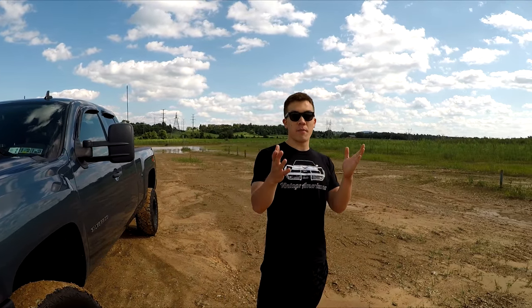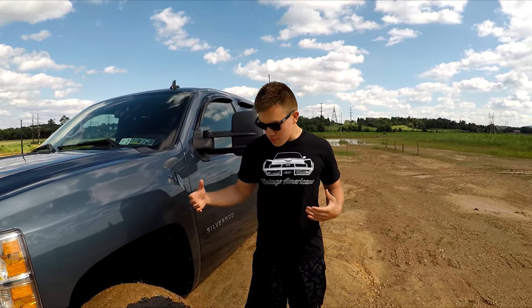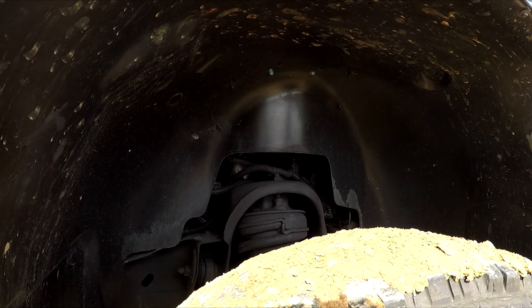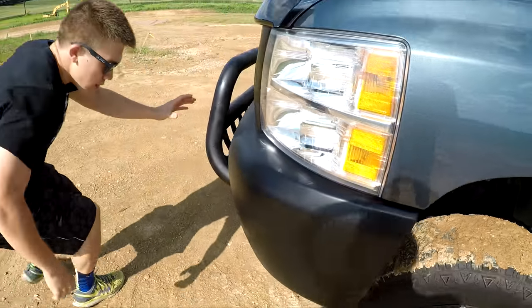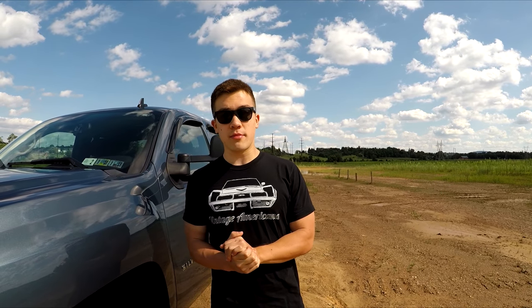Just in case you guys were wondering, Mike is recording today. So moving back this way a little bit — if you look under here, you can see I got this Rough Country 3.5 inch lift kit. It's just a spacer with a 1 inch diff drop. The angle isn't really too good if you look under the truck, but I haven't had any problems. Along with the Rough Country 3.5 inch lift kit, I have a 1.5 inch Zone body lift, so I have a total of 5 inches of lift on my Silverado. I do want to go bigger sometime down the road.